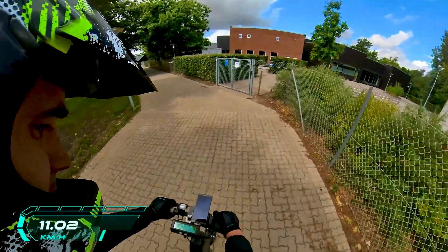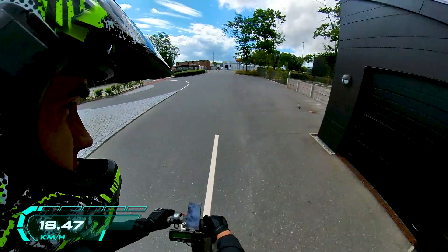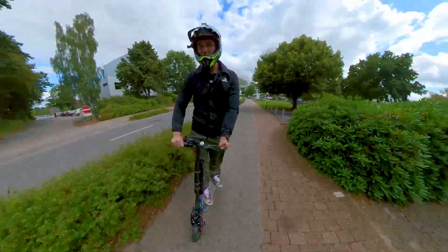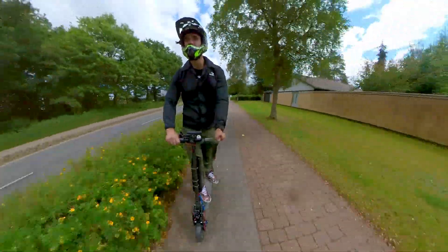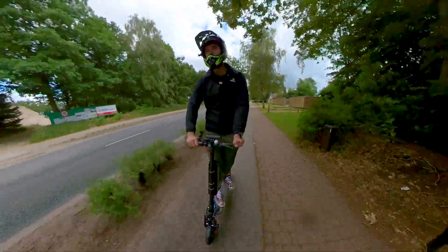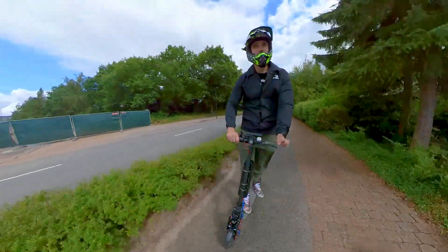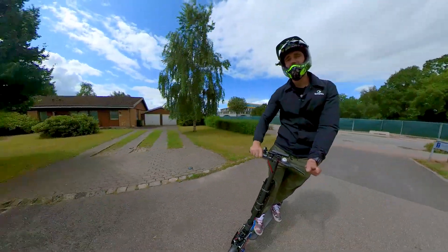The brakes are impressive — I can press the front brake and my rear goes up like there's no tomorrow. The front disc brake is really, really good; I can block the front wheel and the rear of the scooter lifts up. One more thing: this controller allows for cruise control, which you can set the duration yourself — 1, 2, 3, 4, 5, up to 20 seconds, whatever you want. It also supports regenerative braking, so the harder I press the handle, the harder the rear wheel brakes. I have front and rear brakes and can stop really, really efficiently.